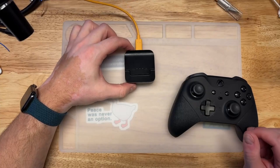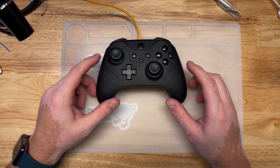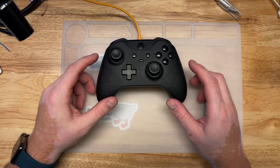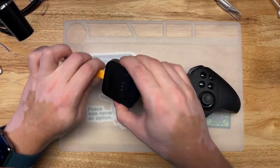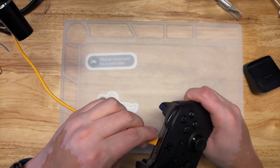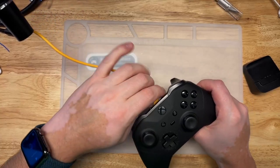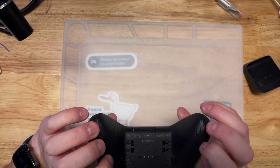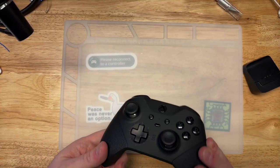If I plug in its charging base and attach it, I see a draw appear of 5.2 volts, but 0.1 amps, which is basically not charging. Just to rule out that it's the base or the pins on the back somehow. Same deal, 5.2 volts, 0.1 amps, and then it shuts off. So, it wasn't misrepresented. Guess we're gonna have to go inside and see if the fault is correctable.